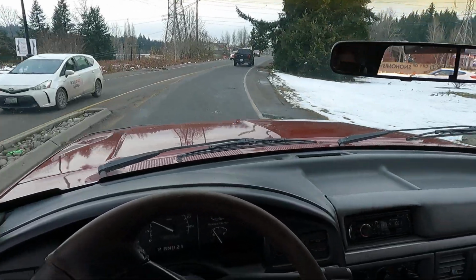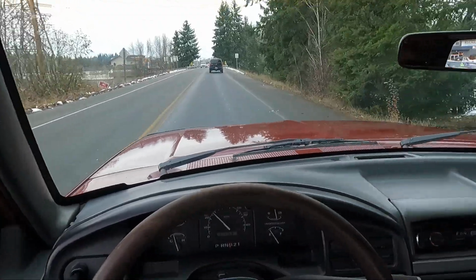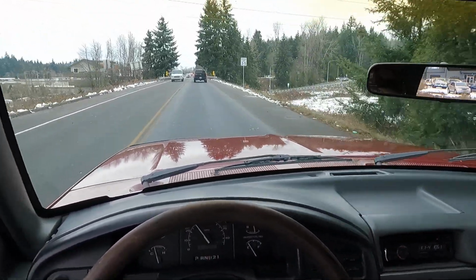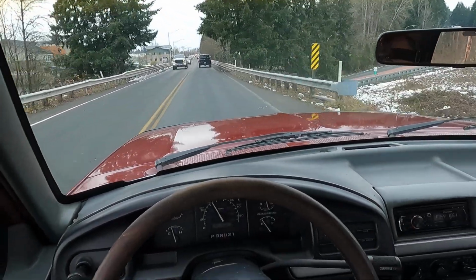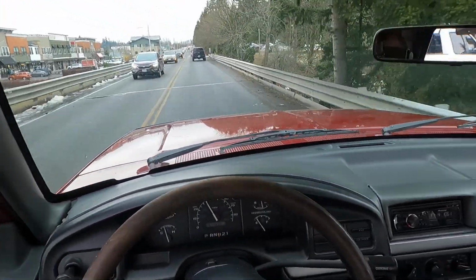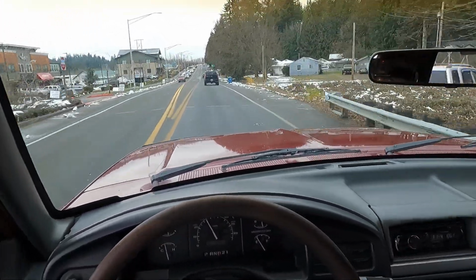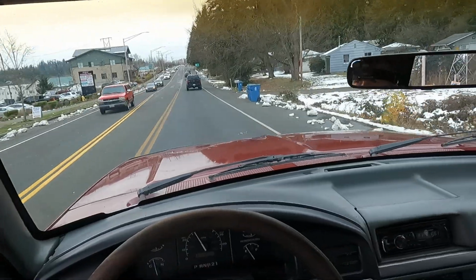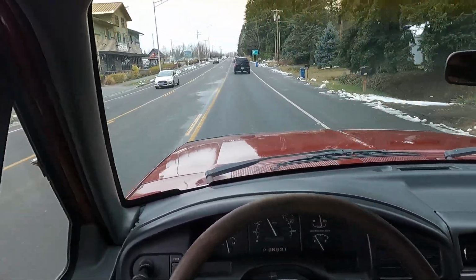So I'm gonna leave the muffler on there just because it's not a late model vehicle, it's a classic truck, so a lot of people would probably put a performance exhaust on it. Just a regular OEM muffler would go on there fine. There's no rust pinholes in any of the other exhaust, tailpipes or anything. But these sound great with like Flowmaster or Borla, and especially if you get rid of the cat, you always want to leave the O2 sensor in there, but that's kind of up to the owner.